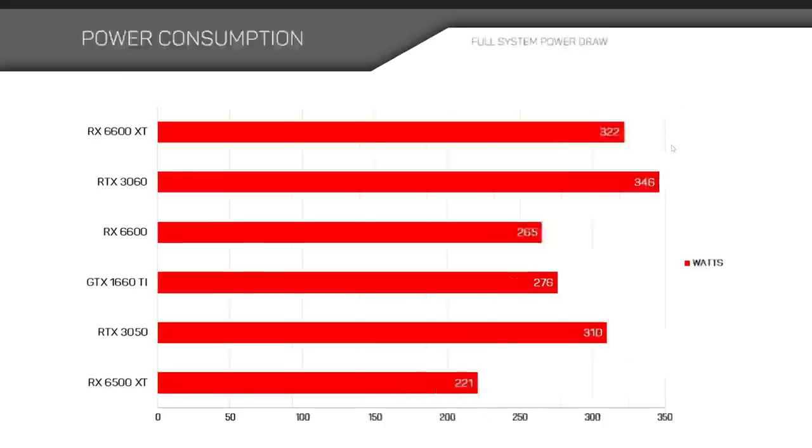Before we dive into performance though, let's take a quick look at power consumption. This is measuring full system power draw in watts. I just used a Kill A Watt from the wall. So it is measuring the entire system load, not the individual graphics card consumption. But here you can see we've got the RTX 3060 being our power hog of the bunch at 346 watts, with the RX 6500 XT being our power hero, I suppose, on the opposite side of the spectrum at 221